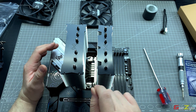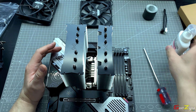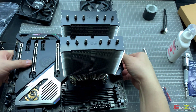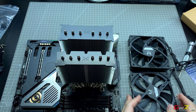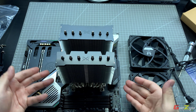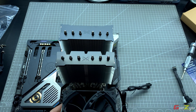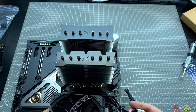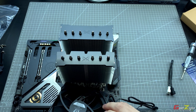As I mentioned, I'm not taking out the sticker from the block for this demo, but you should take it out, clean it with alcohol, and apply thermal paste before mounting the heatsink. Once you've done all this, the next thing is to mount the fans. Before mounting your fans onto the heatsink, find the correct orientation based on where your CPU fan header is — either at the top or bottom. If it's at the top, make sure you align the cables near the top on both sides, because when you do the connection with the splitter it should come out at the top.